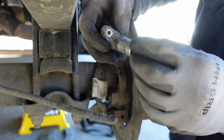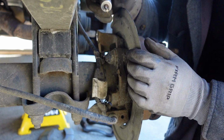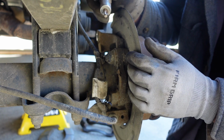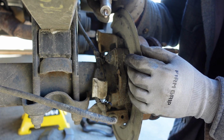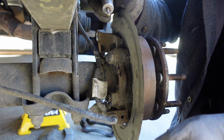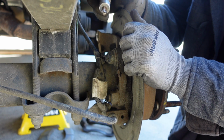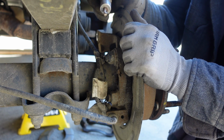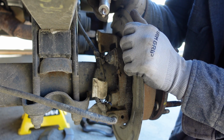And maybe later I'm going to try to do something, because on these vans, traction control, you can turn it off, but once you get past a certain speed, like maybe 10 or 20 miles an hour, I don't know, I've never really paid attention, it comes back on automatically. You can't do burnouts. You can't peel out in the mud. It cuts power to the engine.